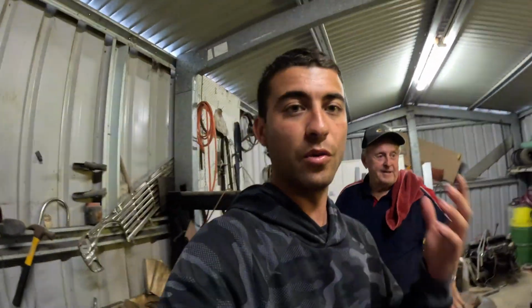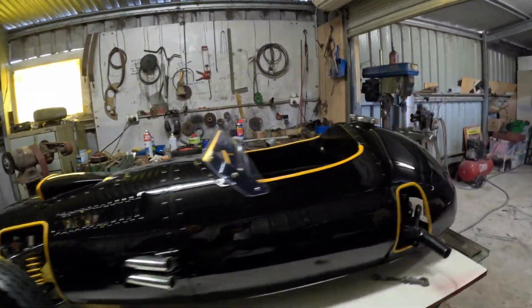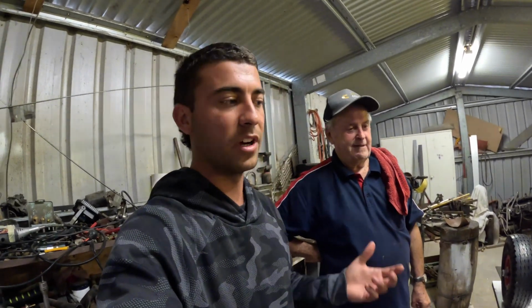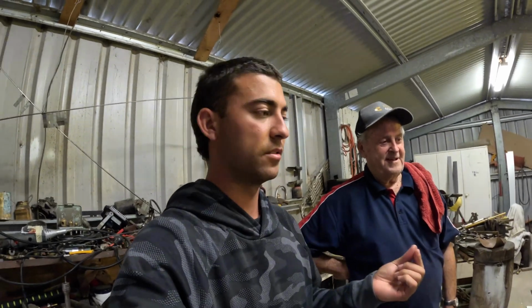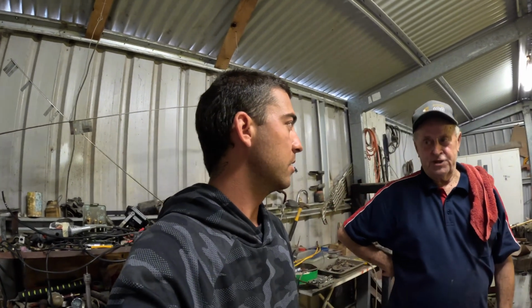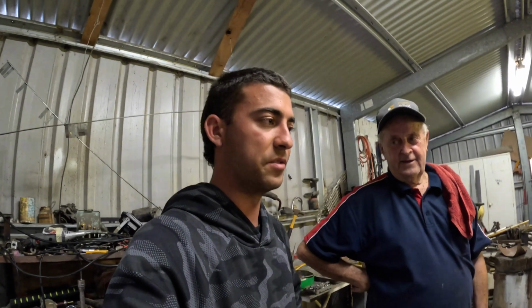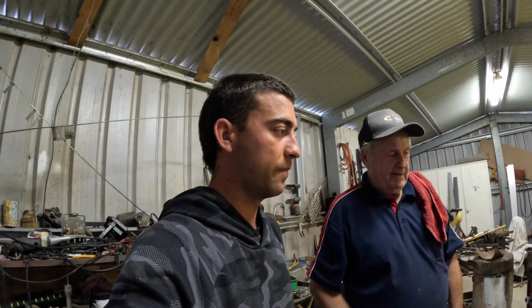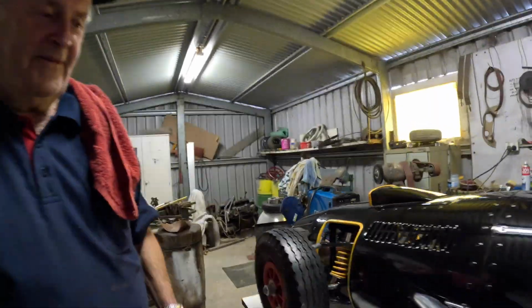Yeah, that's it. That was one of my biggest questions, because these cars are all handmade by Andy. One of the questions you'd be asking, I know I was thinking, is how does he get it so round and perfect? And that's pretty much how he does it. Yes, that's right. And hence why he uses that 1mm cold drawn sheet steel, because it's easiest to mould for building bodies. And also the shocks.